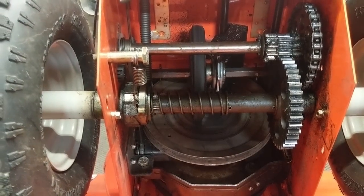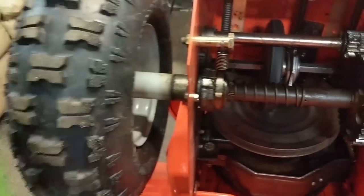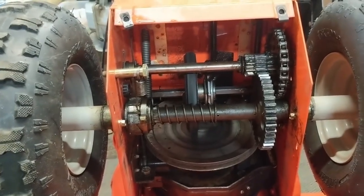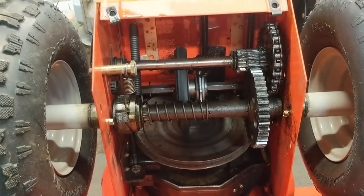If you can get your hands on it, I would recommend using a quick-dry black graphite lubricant. You can go in there and spray the dogs — as they call it — and basically that'll just prevent it from dripping down onto your friction wheel disc and prevent your friction wheel from slipping.